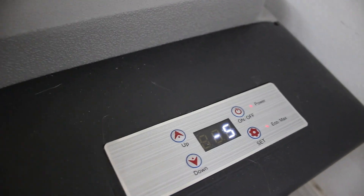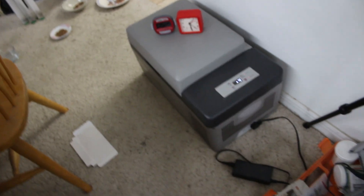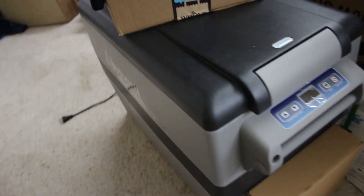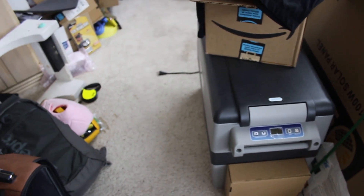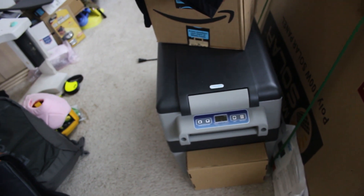It takes about 0.7 of a kilowatt hour per day, which is actually a little bit more than the big one — so that's kind of surprising. The little one in the long run used a bit more power than the big one, mainly owing to its duty cycle being fifty percent instead of a third for the big one.